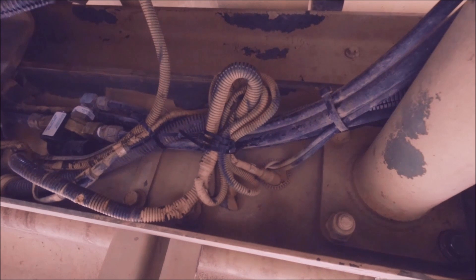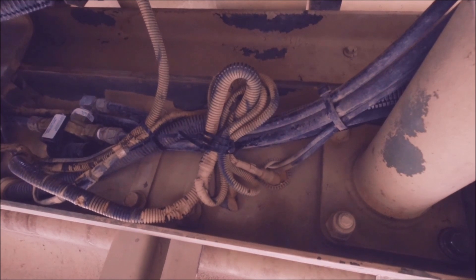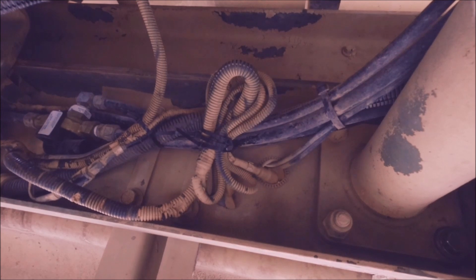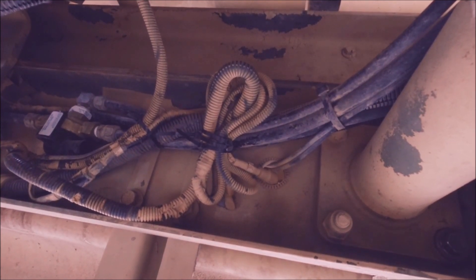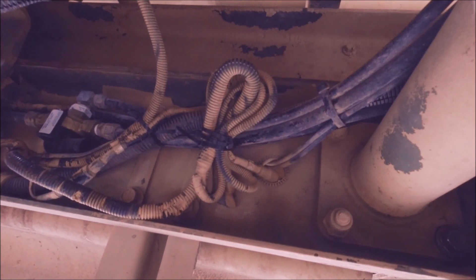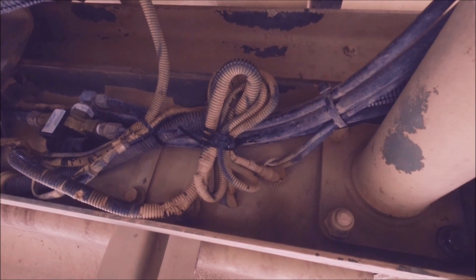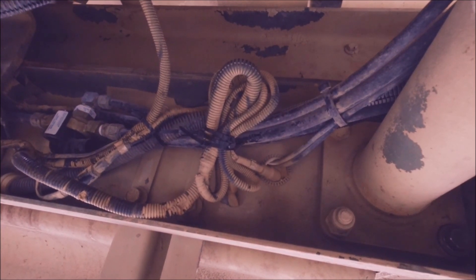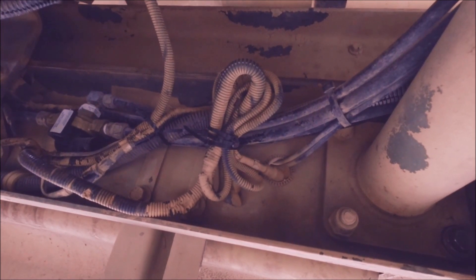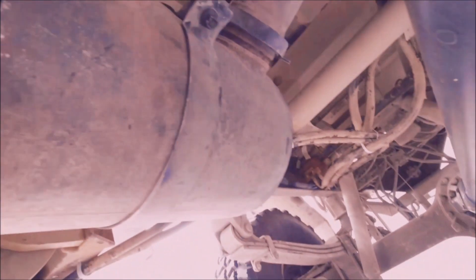That wire cluster is an extra set of wire ends and things that come on the harness. I believe the same harness is used on the M1084 truck to go out to the crane for some of the controls — that's why. Those are just capped off. I secured them up there because I believe I'll be able to use those in the future, since the wires go up to the other pigtails inside the dashboard cluster installed with the tachometer. So that's giving you some wire infrastructure that comes down to the frame of the truck. Everything from basically this point back is secured.